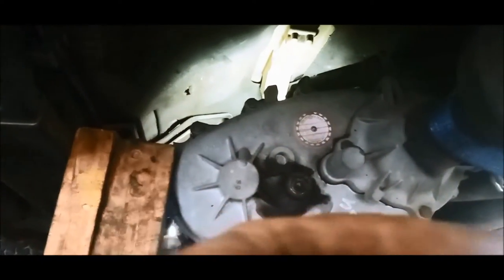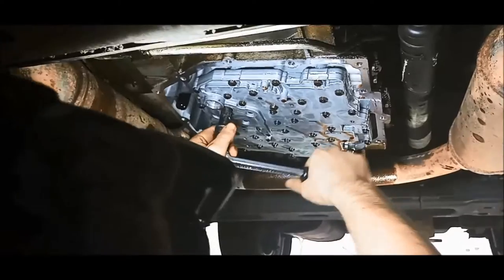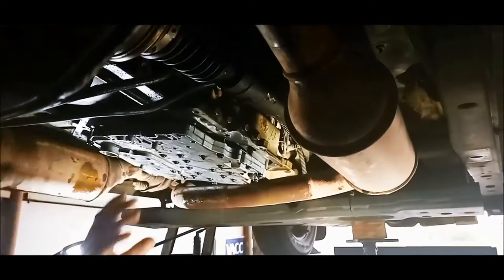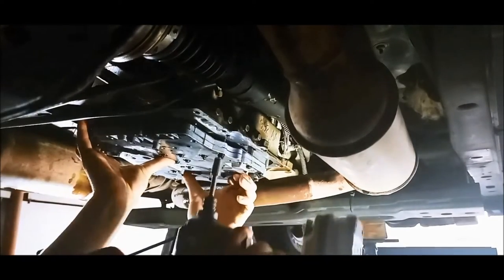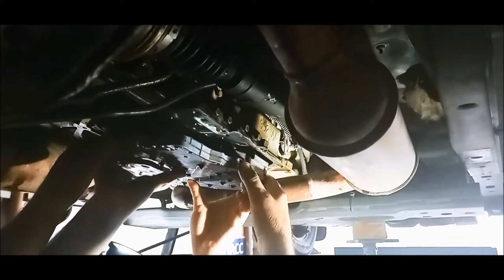We've just put a couple of blocks in there just to push the whole transmission and transfer case assembly towards the right, and put a strap and a clamp there because we don't want that crushing our hands while we're working up there. Now we're going to remove just these 10mm bolts — you can leave the Torx ones in there for now. Just loosen it, let that drain out. Let it down a little bit — got the accumulator valves and pistons.